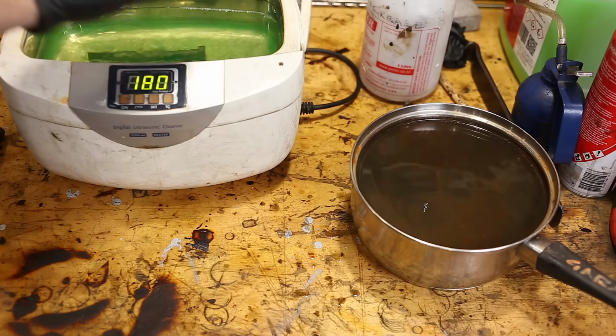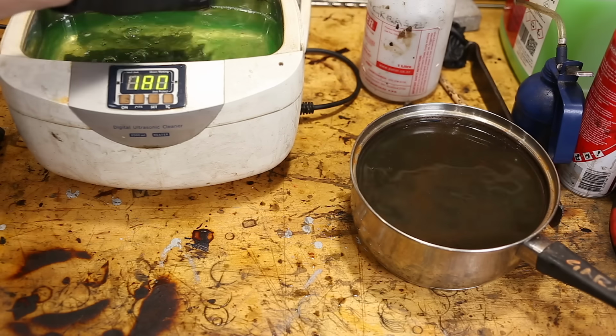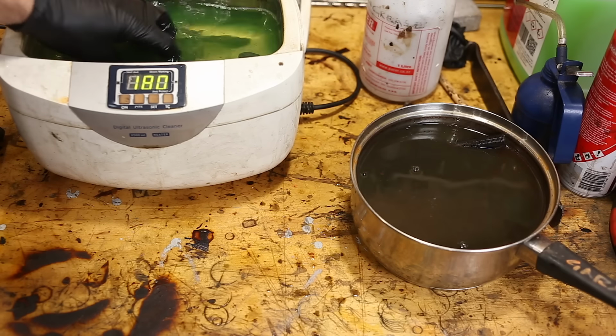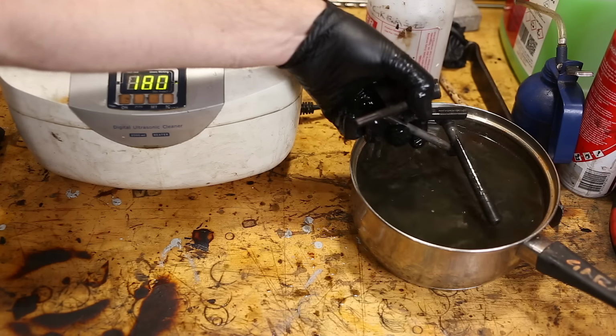Another thing you need to be aware of if you're plating high-stress hardware is hydrogen embrittlement. Now, we're not going to go into that because I don't think there's anything on a series Land Rover that you need to worry about, but I guess don't practice electroplating by doing your head bolts over and over again.